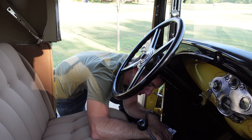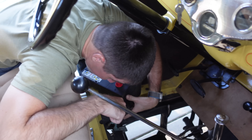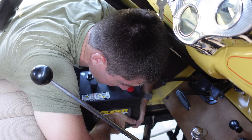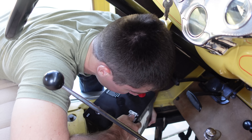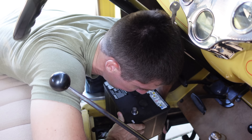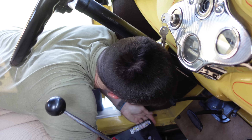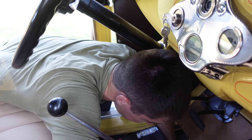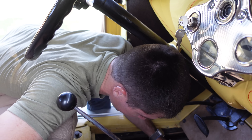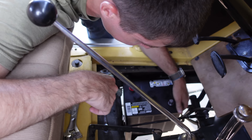It's a nightmare to put this battery in — I've got to get under my steering wheel and contort my back. I'll do about anything to avoid it. You need the red to go the other side — good call. I saw the chassis cable and said no. On this thing it has a positive ground system, so the positive post on the battery goes straight to the chassis. This is a 9/16th bolt, and it really doesn't take too long to tighten it down by hand.